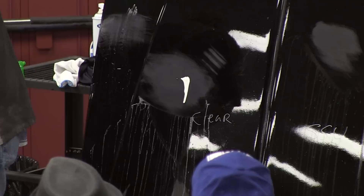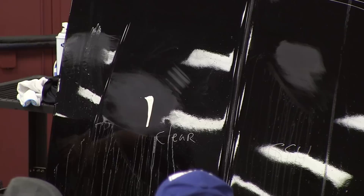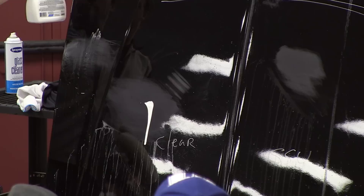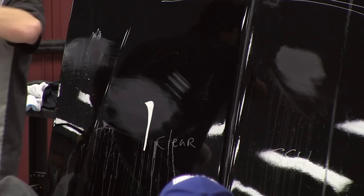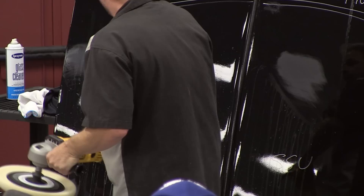About a quarter size or a dime size. My pad is dry — I want friction. It's liquid sandpaper, let's face it. But I don't know what's on this pad, so I'll either use straight water or this detail spray — it works really good as a pad lube. I give it a spritz. It just gives that little bit of pre-lubrication on the pad so you're not going to have dry-on-dry contact, especially since we're going to have revolutions.